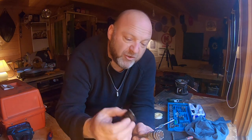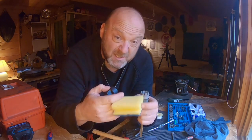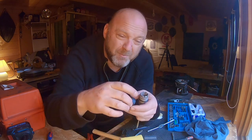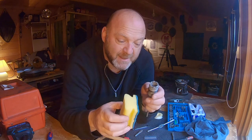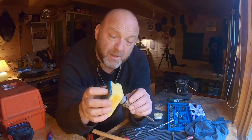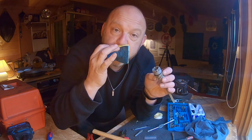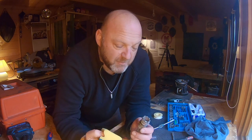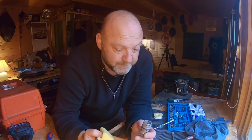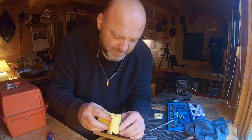Basically what I'm going to do is jam something in there that will let the air come through or squeeze through under pressure, but will catch the bulk of the oil - like this rag did. I'm also going to seal this edge here with silicone when I pop the cap back on, so anything that gets past the sponge will also be trapped. Any air or oil residue is kind of forced up through here.